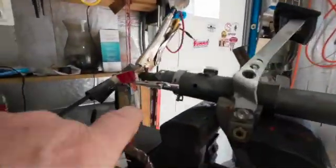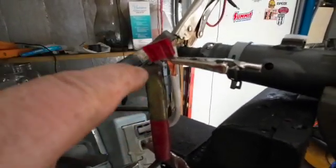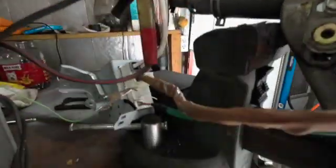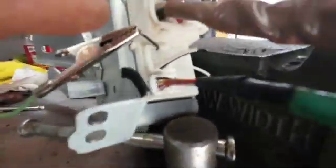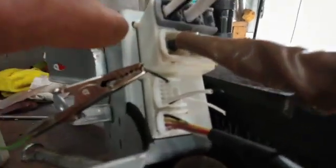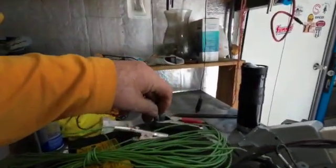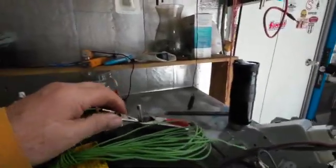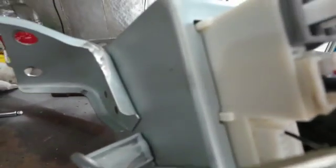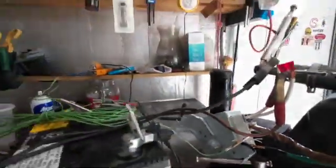The white wire on mine goes to the hot side of the battery. I put a fuse in the middle of this just in case there's a short. For me it's the black wire that's closest to the wire that heads toward the steering unit — there are two or three wires down here that aren't hooked up, but this little black wire is hooked to my hot post also. When I put this on, there's a little click — not a very big click, but that tells me it's working.